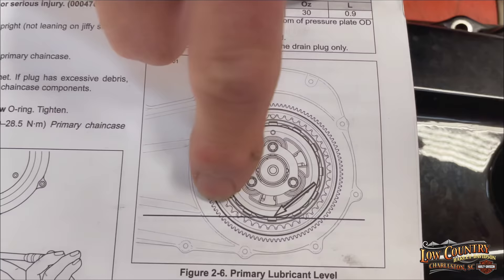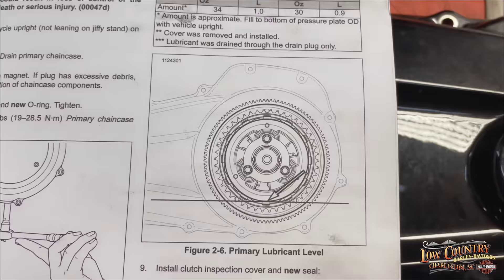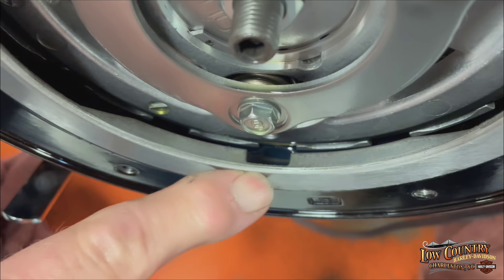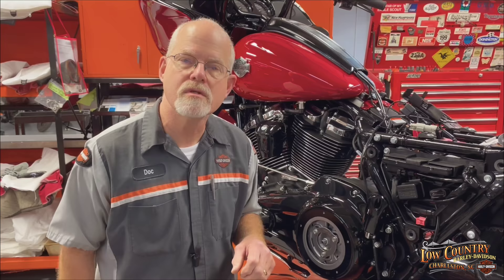The manual shows a picture of where they want you to have it — pictures are fantastic — but I happen to have an M8 on a lift, so let's walk over there and I'll show you where it's at. The cameraman can zoom in and you'll see the fluid level just barely touching that bottom area. That's the correct amount of fluid for your primary. I appreciate the phone call, and I love it that you're using your service manual. If there's any time I can clarify what the service manual is telling you, I'd be happy to do that. I'm Doc Harley — we'll see you next week.